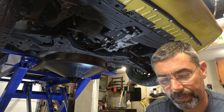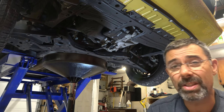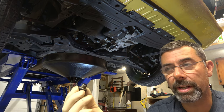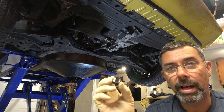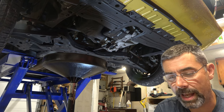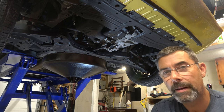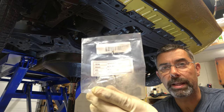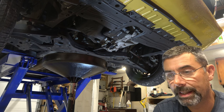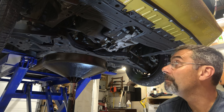While that finishes draining, we've got to take that little silver washer off. Sometimes it's just a matter of taking your finger and picking at it. Other times, because it is so crushed, it'll take a little screwdriver. You don't have to pry it off. I've got the part number for those replacement washers — MD050317. I bought a 10-pack of them for like $6 on eBay. That's less than a buck a pop.